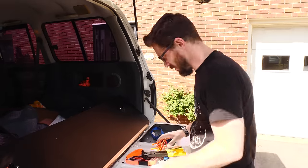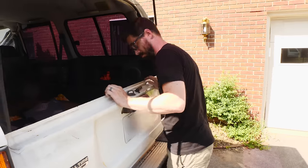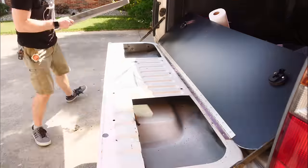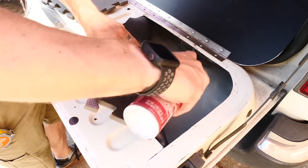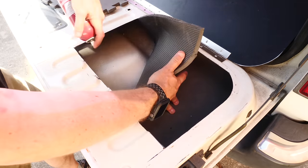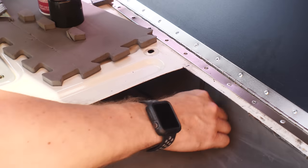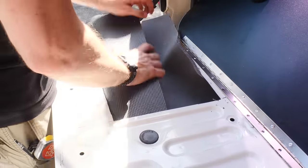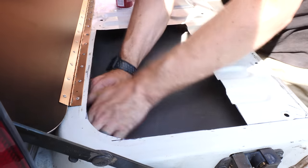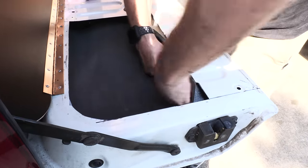I'm just going to throw some random stuff in here and open and close it a few times to make sure that the door stays in place while it's moving. I used some degreaser to clean off all the surfaces both on the top and down on the inside before adding some foam. I wanted to cut down on the noise of any metal straps or tools bouncing around in here, so I cut some EVA foam floor mats to put in. I cut them as big as I possibly could, forced them into place, then peeled up each corner and added spray adhesive. I cut these pieces well oversized and went back and trimmed out anything that was in the way. I did have to cut out a lot of stuff at the top to make sure that the latch could freely move so that the tailgate could lock into place. The white paint was still in pretty good shape so I decided not to paint the inside, and I used some acetone to remove those extra Sharpie marks from before. After that was done, this thing was finished.